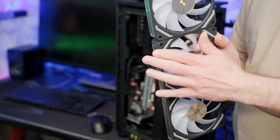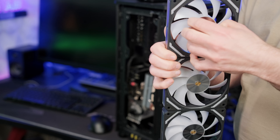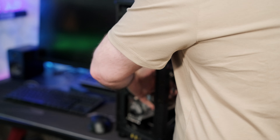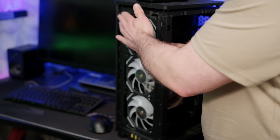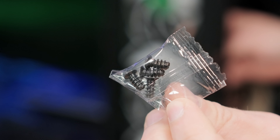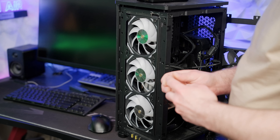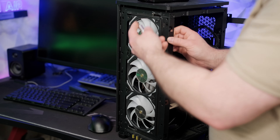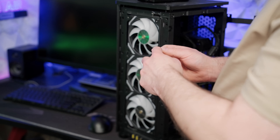I can have this showing without the little pattern outside. These fans I don't think are flippable — nope. Now the first thing I'm going to do is connect the power. The RGB is for the back so I can do that later. I'm going to put the screws in — included are two different screw types, multiple bags, three of each. I'll use these ones for connecting between the case and the fan, and the long screws would most likely be used for a radiator. This one does not get in the way of my case. It's more compatible.